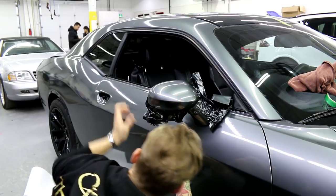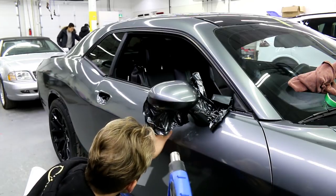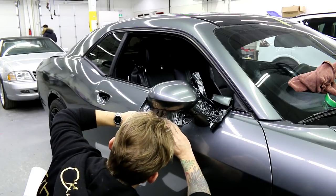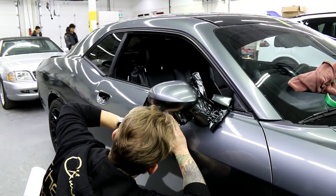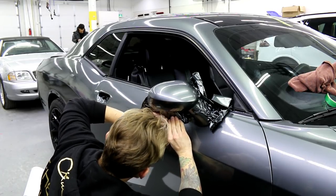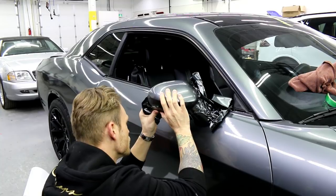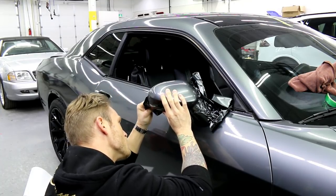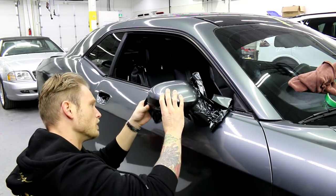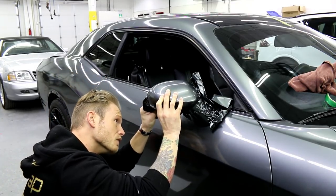As I had my knifeless tape set up, let's shrink this back. Not a lot of pullback. I always let it shrink first before I stretch again — it's super important. I'm taking my fingers and spreading out the wrinkles — that's what we're always trying to do, spread out that tension. These are going to look pretty awesome when they're done. I'll probably be done this in about 10-15 minutes.